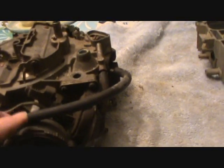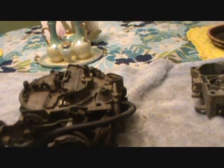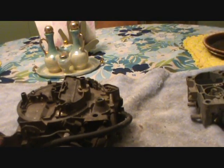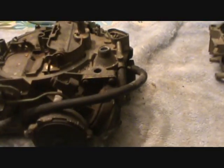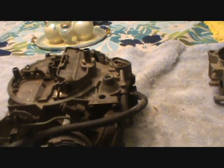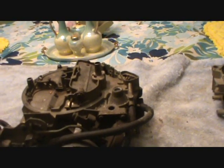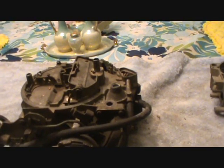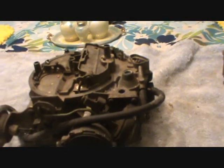I'm going to show you a couple of things people do that mess these up - that's the only way I know to describe it. When you have a Quadrajet and you stomp it and instead of taking off smoothly - you hear that 'whoosh' - what it does is nose over for a second and backfire, or it goes 'boop' then won't take it, won't take it. Or you basically have to get the engine up to higher RPMs for the four-barrel to come on smoothly. In the next video we're going to start looking at this and solving these problems - stay tuned.